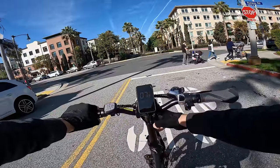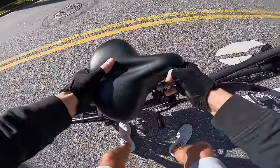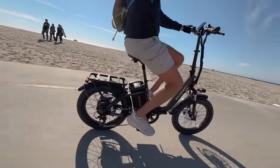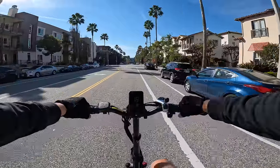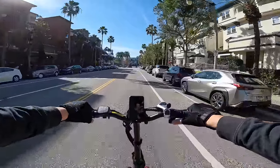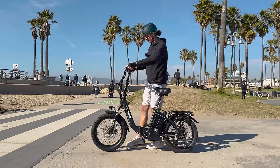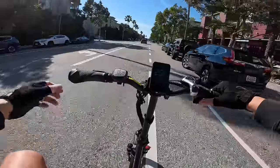I really need to raise up these handlebars and seat. One of the nice things about adjustable folding e-bikes is they can fit a wide variety of individuals. The suspension seat post seems kind of like garbage honestly — I'll put a link in the description for a better one if you want better rear suspension. Let's bump it to pedal assist two: there's about a second of lag and then it really kicks in — 18 up to 20.5 amps. Using throttle only gives us the same pedal assist two output, topping out around 20.5 and then reducing amps down to about 9-10. The bike feels more lightweight and nimble than a lot of stuff I'm used to reviewing, because that 18-pound battery is mounted really low and in the center — really optimal for handling.